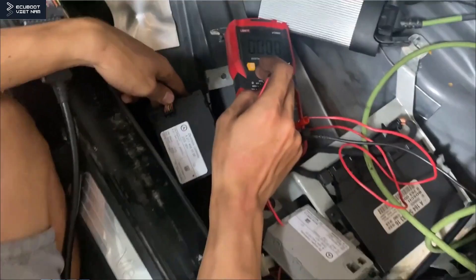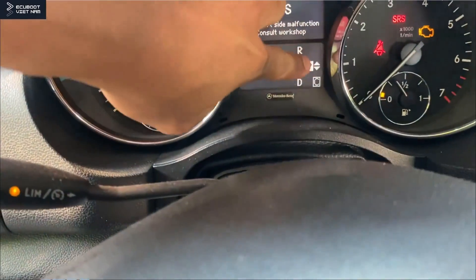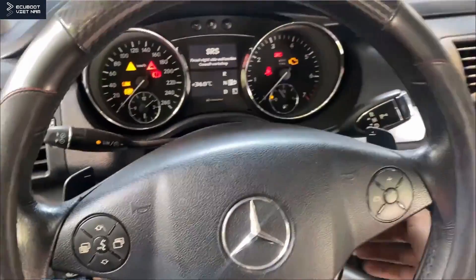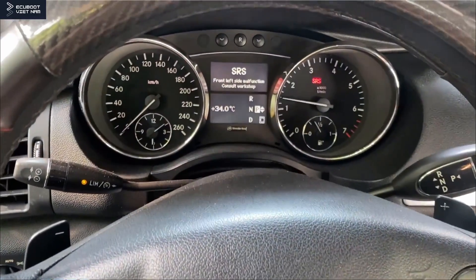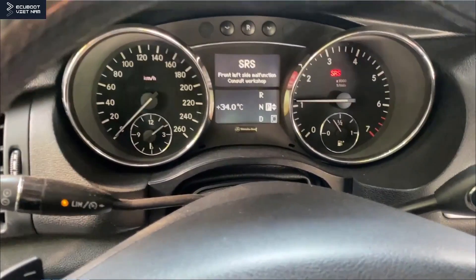Now on the cluster, we have our gear right here and we can start the engine. To conclude, our gateway was losing connection with the drivetrain CAN, and this led to many problems like being unable to change gear and the engine having no crank. In the next step, I'm going to do a quick test to see if we've gotten our connections back.